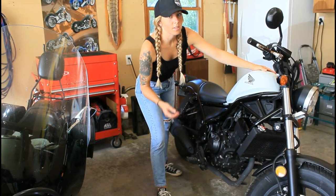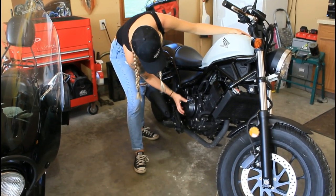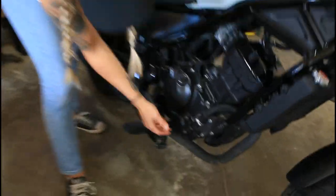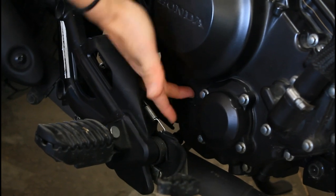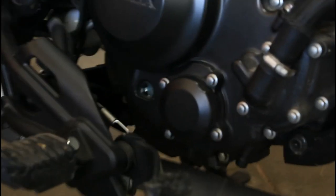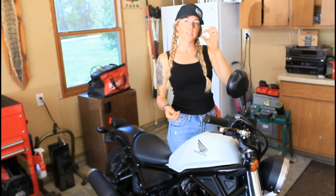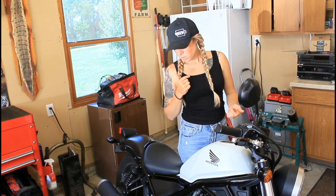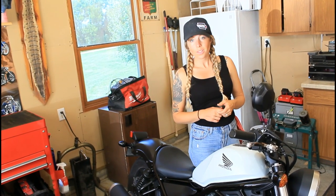To check your oil, you're going to do this one of two ways: either there will be a dipstick, or you'll be looking at a fluid indicator window right underneath the side cover — here's where your filter is sitting on this specific bike, and here is your fluid window. You want to make sure your bike is level so you're getting an accurate reading. There will be marks showing where you want the fluid to be. If you have a dipstick, pull it out and check the indicator marks. If you need to add oil, refer to your owner's manual for the correct type — putting in the wrong oil will wreck your engine.